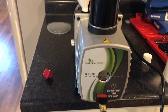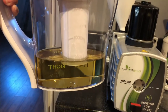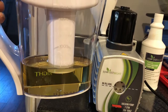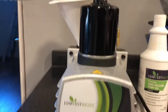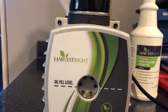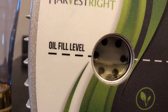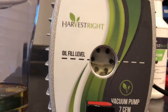We're gonna take our new oil and pour it into the funnel, and I'll probably end up topping it off with whatever's left in the bottle. While I was waiting I wiped out the freeze dryer and filtered the oil I just used. Now I'm gonna put it in and it should top it up completely to where I need it to be, and we can button it up. There we go — now you can see it's topped up to where we need it to be. You can't go above the fill level there, so now we're gonna recap it and hook it back up to the machine and onward and upward.